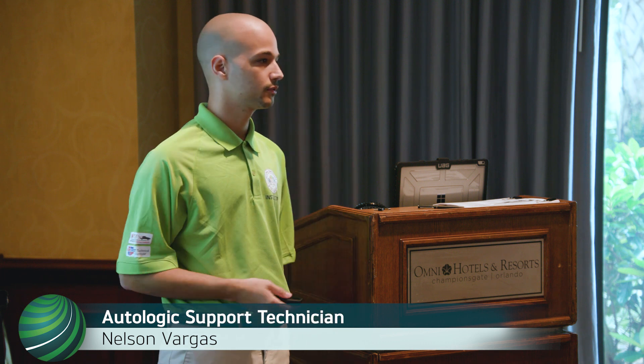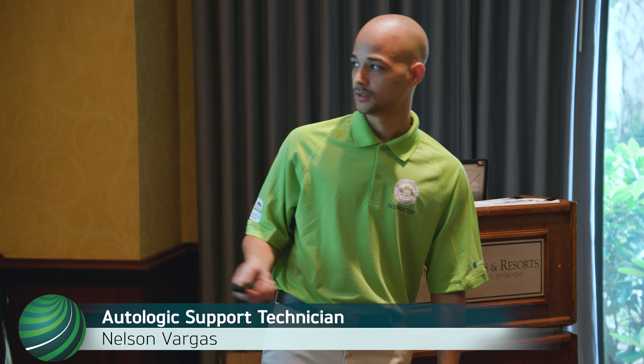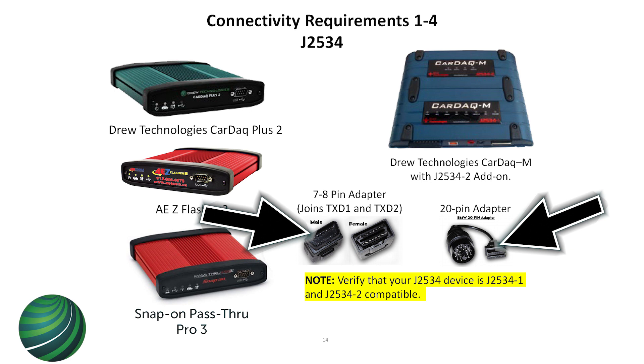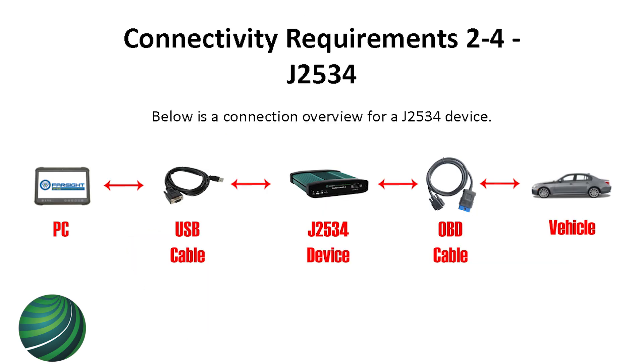This is your regular 20-pin connector for older cars prior to a May 2000 production date. You have to have this connected to the adapter, and then that's connected to the pass-through device for it to work. A lot of guys just connect this to the pass-through device and never got communication, but this also needs that connection through pin 7 and 8 to work. The connection diagram is very simple - PC has a USB cable with a serial port that connects here, and the OBD cable connects to the car.